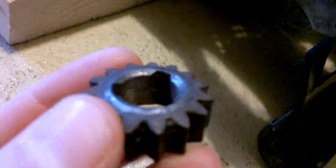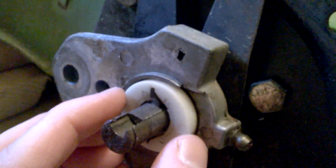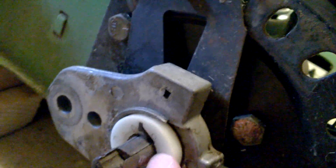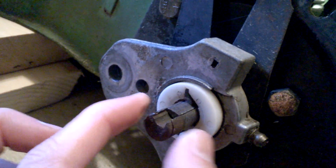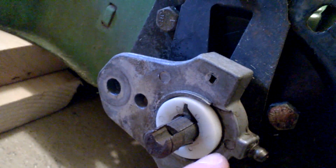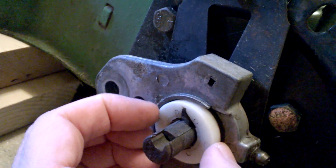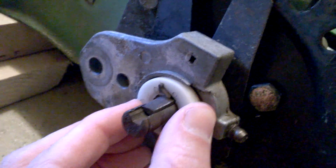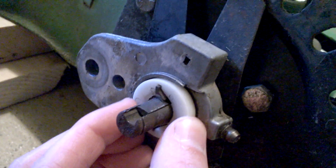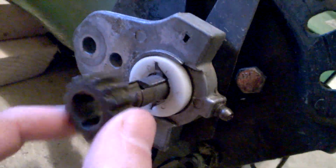All right, so what happens is, if you'll notice on this gear, there's some inner indentions here. Now, when you try and move forward, what's supposed to happen is this is supposed to rub against the plate behind it. Of course, this shaft is spinning. This is going to spin with it, but that spring pressure is going to put pressure against this, which pushes it against the housing underneath it. Actually, there's another disc underneath there, a wear plate, which tries to stop this from spinning, which then turns this guy, and you'll see it lifts up the little edge of that key, which then engages right here and allows that to turn.